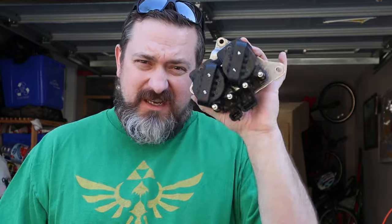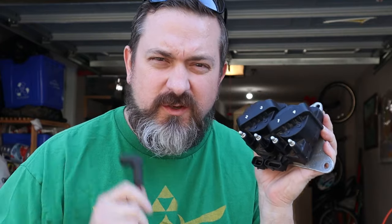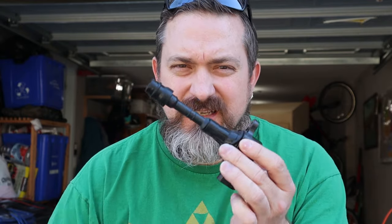If you have a newer car without a distributor, you might have a coil pack. With a coil pack, the coil is built in and you still have spark plug wires going to each spark plug. And if you have the newest cars, you might have coil-over-plug ignition coils where there are no traditional spark plug wires — just a boot that sends the spark directly to the plug. Those boots do come off, are replaceable, and can wear out.